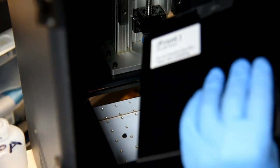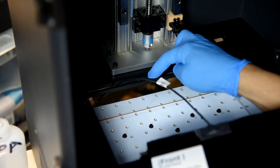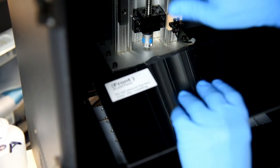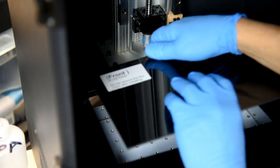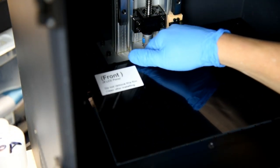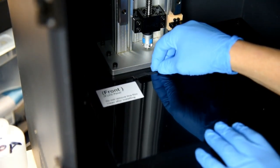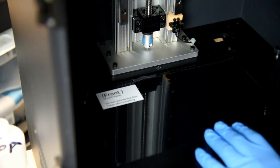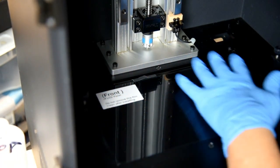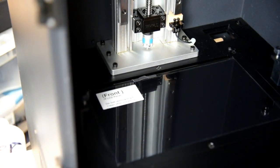So put the cable in first through the front channel here, and you want to bend this flap, not all the way but perpendicular, and then at the same time find the groove here in the front and slowly set it in there, and you'll notice that it sits perfectly flat, which is good because that's what we want.